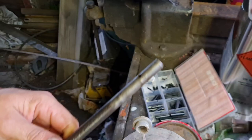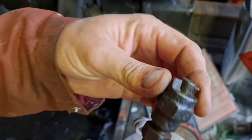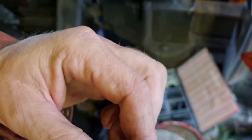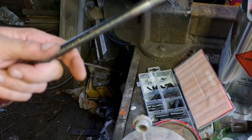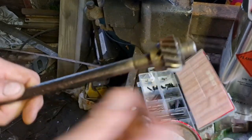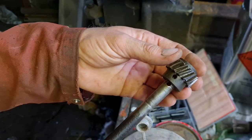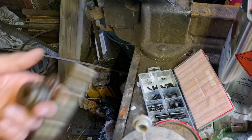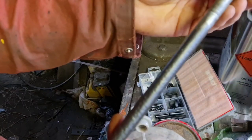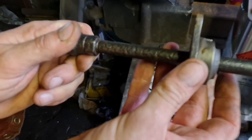As promised, here we have our magneto shaft. I did clean all this up with the wire wheel and freed all this end off, because this is how you set your timing. You can only get it 180 degrees either way on that gear, so we're going to have to set the timing by adjusting that to where we want it. There's the lock nut on the bottom which does work. This end is what we've got to worry about - we've got to put this gear on, which is the one that came off, and the pin goes through. You can see where them holes are. It was a taper pin, but I don't have any taper pins, so I'm thinking can we use a roll pin? First things first, make sure you get this collar on first because if you put your cog on then you ain't got that on, you're going to be in a world of hurt.